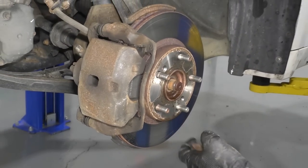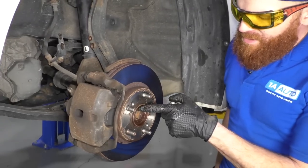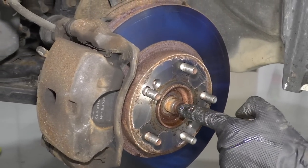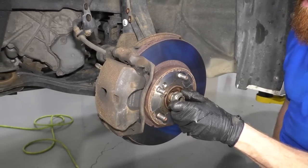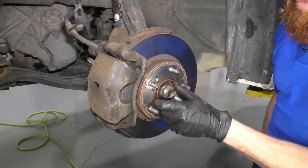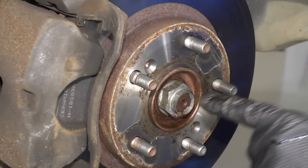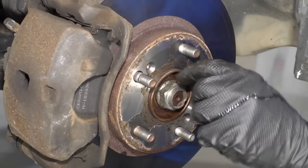There it is. Okay. See if we can push in the axle. We can't. So there's multiple options we can do here. Firstly, you're gonna spray it obviously with some kind of penetrant inside there. Try to get it worked in. Okay. If you have a center punch, maybe like an air chisel with a center punch, you can try to go right in there. That'll help push it through. If you don't have access to something like that, I would just go ahead and I'd take my nut and I'm gonna turn it to the left a little to get it started, but put it back on so that it's pretty much flush, pretty close. And then I'm just gonna hit this with my hammer and bonk it through enough to break it free. Okay, so first step, like I said, we're gonna put a little penetrant in there.